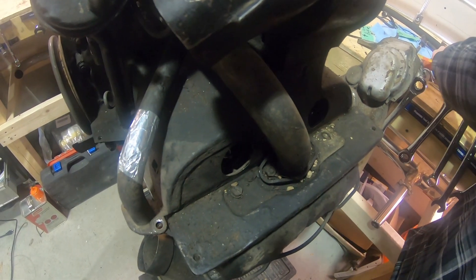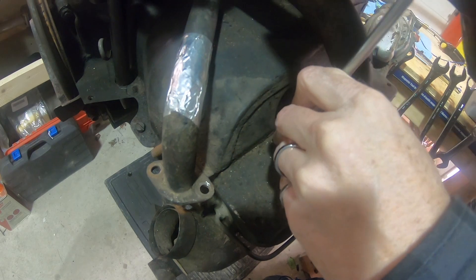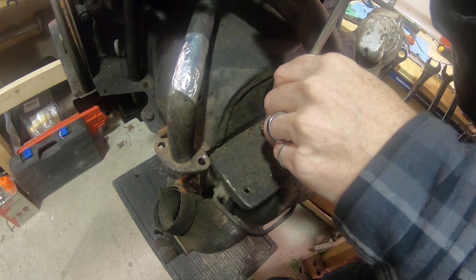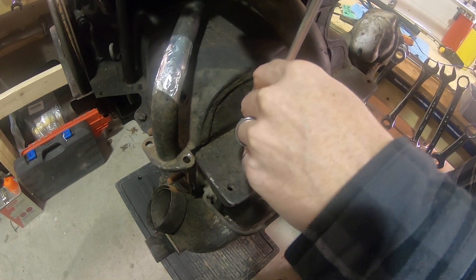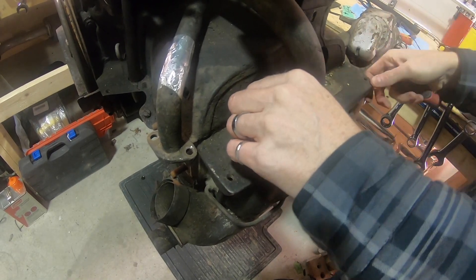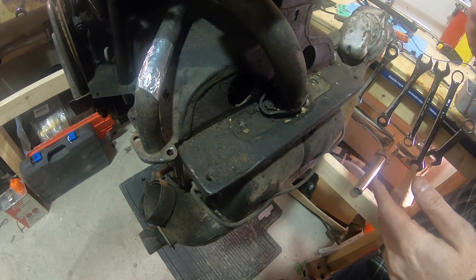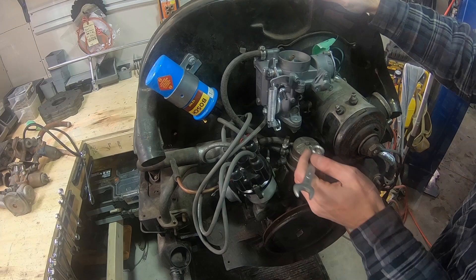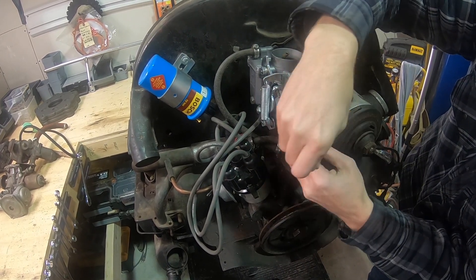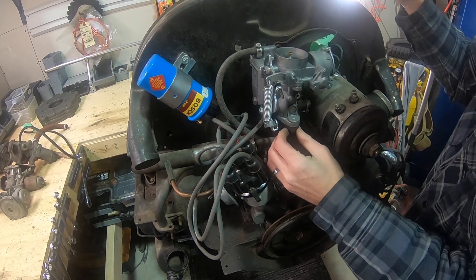Again, slots are not the right hardware for the job. So we have these three on this side, and obviously one is for the fan housing. This is for my cylinder covers, but I will be taking the cylinders off because we are replacing the push rods as well. The fan house assembly is now loose and ready to lift out.